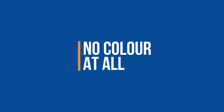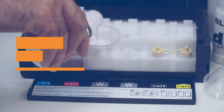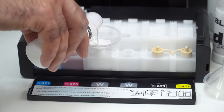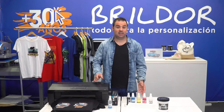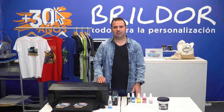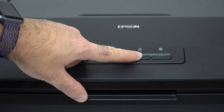No color at all. Especially when printing for the first time, we might find that no color appears on the printouts. This might be due to two main problems. First, initial ink charging: load your DTF printer with ink by opening the cap of each tank and filling it with its corresponding ink. Make sure you load the correct color, which is usually indicated on a label. Be especially careful to keep all the caps closed except for the one you are filling, or you may contaminate all the colors. Once they are full, turn on the printer and press the ink button for a few seconds. This will restore the initial charge, which can take up to 20 minutes.